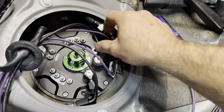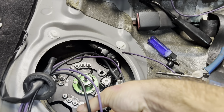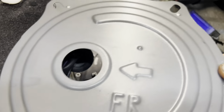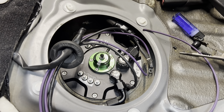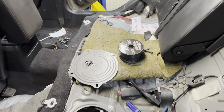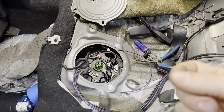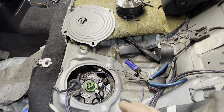The harness is complete. We've got pump one terminal ends, pump two terminal ends, and the level sensor terminal ends. At this point we could send everything through and mount the cover, but the most important part of doing a fuel system right is testing beforehand. We know the lift pump is already plugged in, so we'll test that first, then individually test each of the main pumps. The test is simple: apply power and ground briefly and listen for the pump to spin.